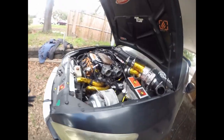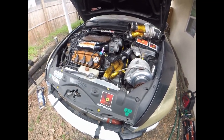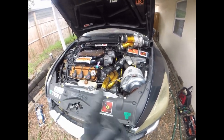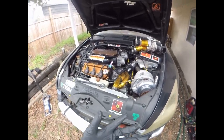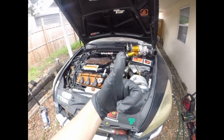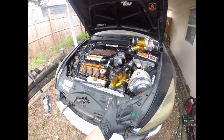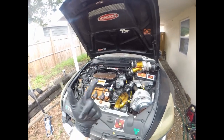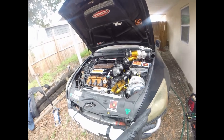So literally, if you measure it off, I took off about 4 to 5 feet of charge pipe, which obviously, once the turbo fills up the charge pipe, it starts building boost a lot quicker. So just by cutting out that 4 to 5 feet of charge pipe, the turbo starts to spool at 3,000 RPM. It's a 69 millimeter journal bearing Turbonetics turbo, and I'm in full boost by 4,000. So literally my full power band is 4,000 to 7,500, and really I shift around 73.